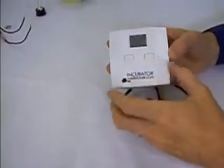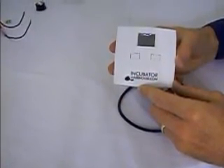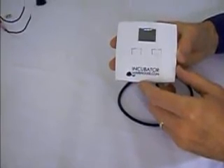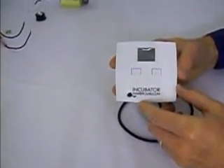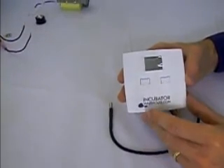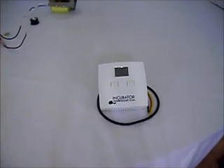Very simple two-button operation, and it comes with simple instructions. A nice benefit is that it has been specifically designed for egg incubators, preset to 99.5 degrees Fahrenheit — you can also switch it to Celsius if desired. There is a 220/240 volt version for people in countries that use that voltage. This probe is very sensitive; it picks up temperature changes rapidly and turns the power on and off accordingly, making for a very steady temperature inside your egg incubator. Each of these thermostats can be found at incubatorwarehouse.com, with the exception of the water heater thermostat, which we showed to demonstrate the pros and cons.